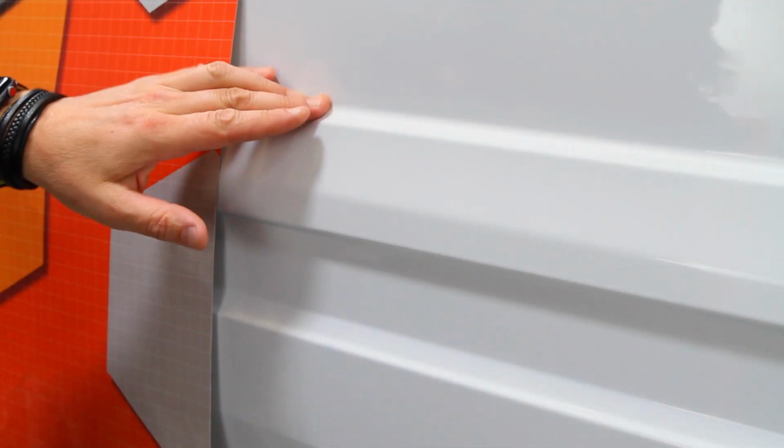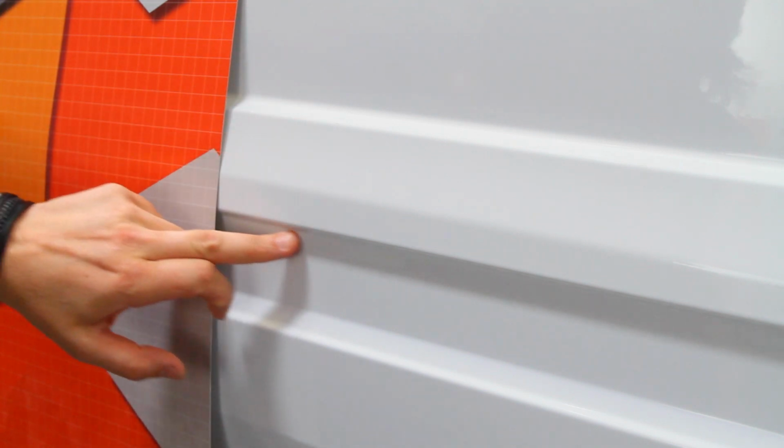So, once again, here we are talking about the challenge of vinyl lifting out of deep channels and recessed areas. What we really need is a deep channel hack. We often have to install vinyl over channels like this and these. Of course, if you just force the vinyl into them, you would be overstretching it, and in a short time the vinyl will shrink back and lift, creating bubbles and ultimately an application failure.